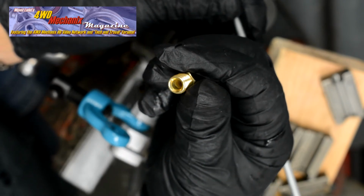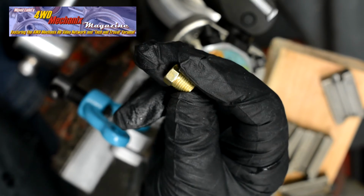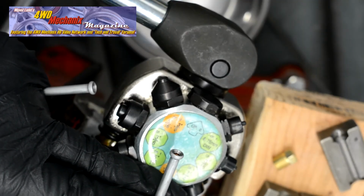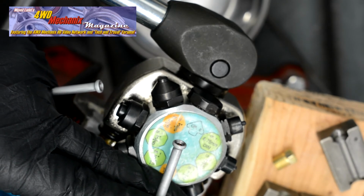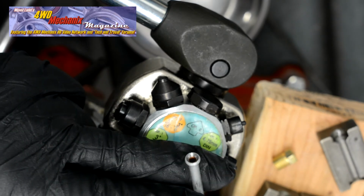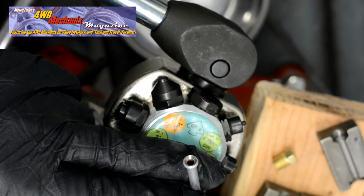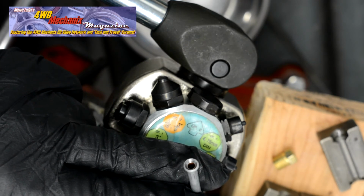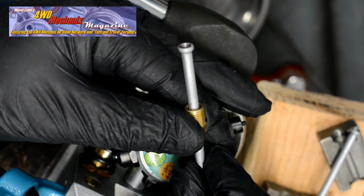Using the correct flare nut is essential. This flare nut has a 45-degree bevel that will match the backside of the new flare. Note that the outer or double flare is concentric and the same size as the inside diameter of the tube. This nicely formed 45-degree inverted flare seat will provide a good seal and uniform flow of brake fluid.